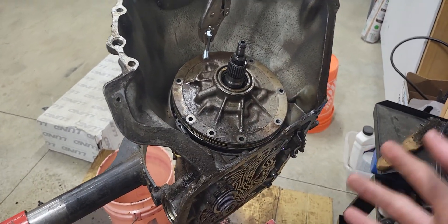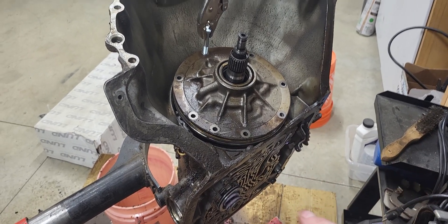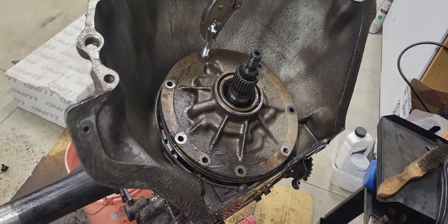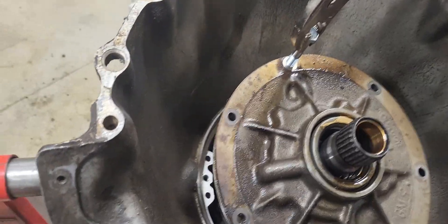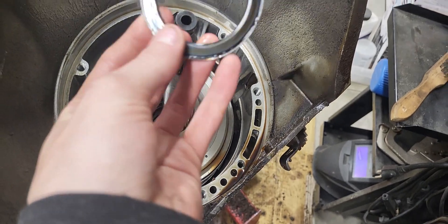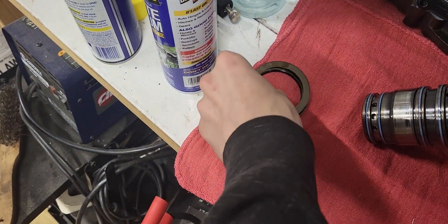What I'm going to do is take apart half of it. There's a snap ring that's really difficult to get out right on the third gear clutch pack, so instead of sitting there messing with it for a half hour on camera, I'll just end the video and start recording again for part two. First things first — get the oil pump out. Once that's done you can just grab onto it and pull it free. This ring here is actually part of a bearing that goes up on the shaft for the oil pump. It's just a roller bearing — this one doesn't actually look all that bad.